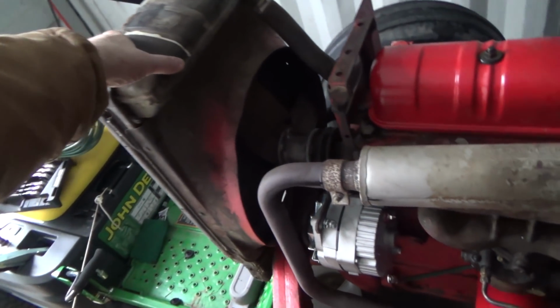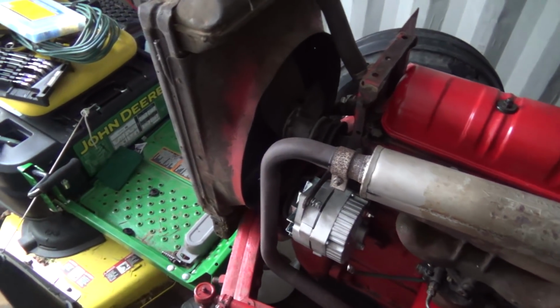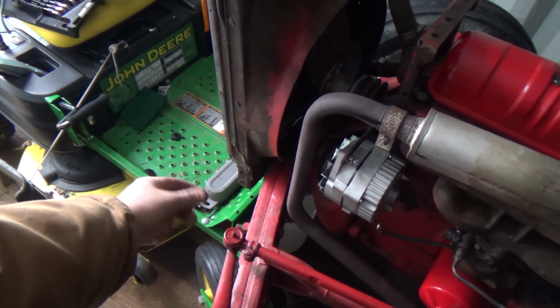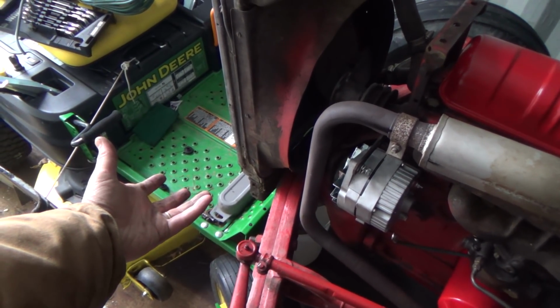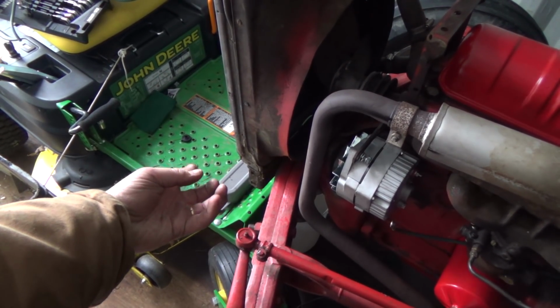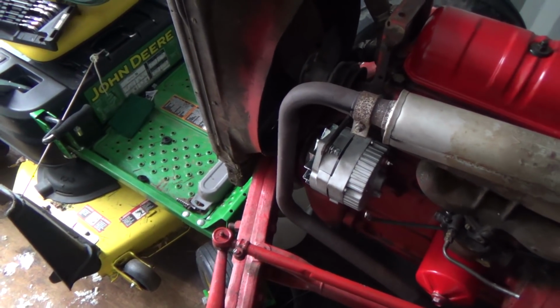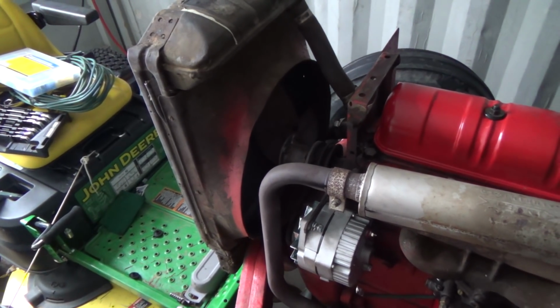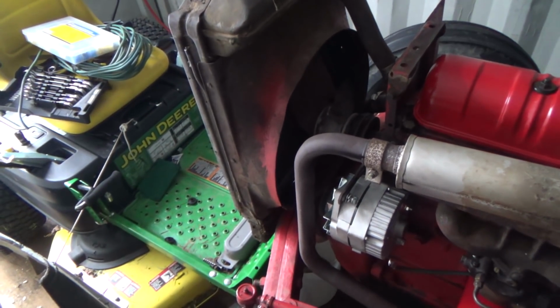And I think for now I'm gonna leave the radiator as is. It's probably fine. I think it's got a problem on this side though, where it's spinning inside of the housing. You can't get in there. They're supposed to be, I guess, welded on the inside and then pinch welded shut, and it's spinning there. So I can't do anything about that, or I have to cut the thing off with my torch and put a whole new rad on it, because you know that's what you'd have to do. But it's not leaking, so I think I'm going to leave her for now.